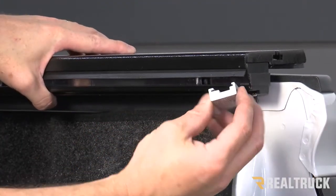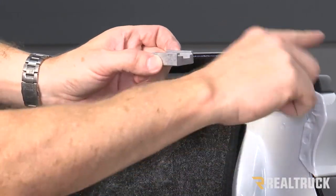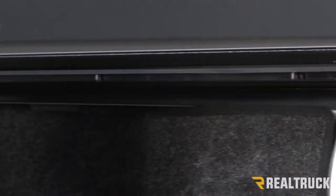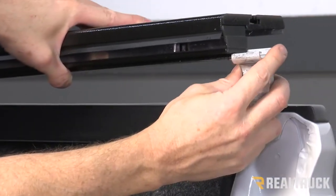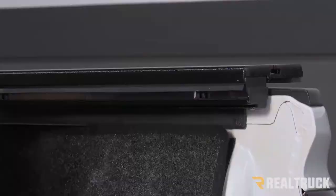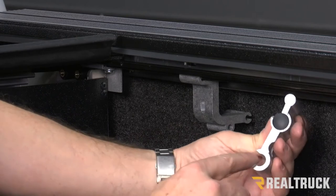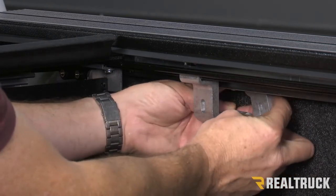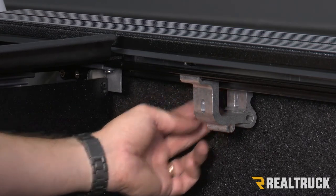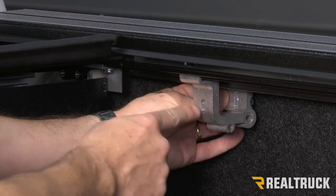After we slide the large clamp in place, we're going to take our spacer clamp. You'll see there's a hole on one side and a track that's kind of offset — that goes closest to the bed cap. That cutout is because there's a little screw that sticks out of the bottom and you need to clear that screw. That's going to slide in place. Then we're going to take our shorter clamp and that's also going to slide into the rail. Next, we're going to put the second half of the clamp together. We take this open C portion and slide it over the back side of the clamp. Now this will rock back and forth — we've got a barrel nut with an opening on one side. We're going to slide it so the barrel nut opening is facing this side here.